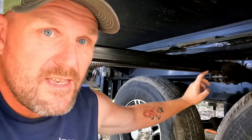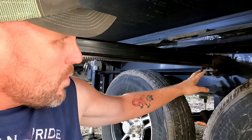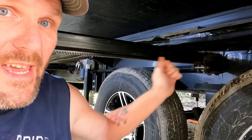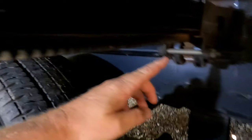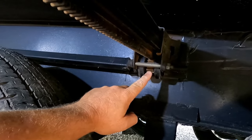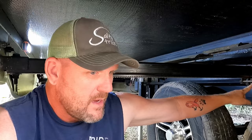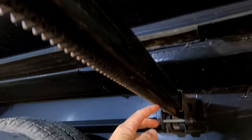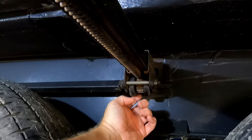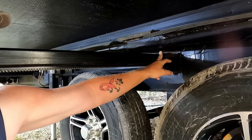We're underneath the slide here. This is a through-frame slide-out where it's got little gears that drive it in and out. My first assumption was either one of the teeth on here were broken, or maybe some teeth on this gear were broken. I watched another video where somebody had the exact same problem and he was missing a couple of teeth off a gear and replaced the whole thing. I've looked both of them over quite a bit and I can't find any broken teeth — nothing's bent or broken.